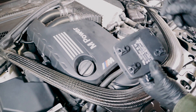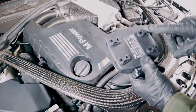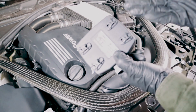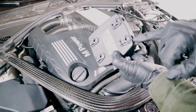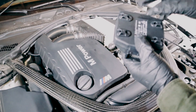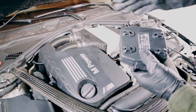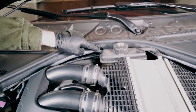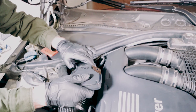Next up is to install the four mounting pins on the RaceChip itself. The really nice thing about these mounting tabs is that there is a locking tab on each side of each pin, so if you ever need to remove the RaceChip for service or warranty work, instead of having to cut the zip ties, you can simply press the locking tabs to leave the zip ties and mounting pins in place but remove the RaceChip. You can also take the zip ties themselves and mount them up and down or left and right. In this application, we've routed the RaceChip wiring harness around the rubber gasket on the backside of the motor, and we're going to mount the RaceChip right here next to the intake.